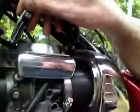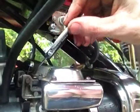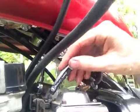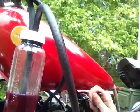There they are attached to the vacuum nipples. Then you go on and repeat with three and four. Down here, right where my screwdriver is, there's a screw — that's what you turn to change it. Turning left will fill up whichever bottle you connected it to on that side, and turning right will fill up the other bottle. You just want them to be even, with an even flow. So: do two and three, then one and two, then three and four, then back to two and three.